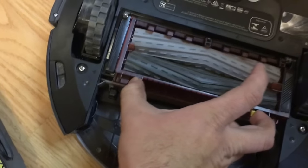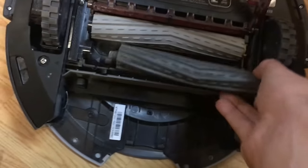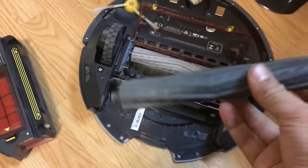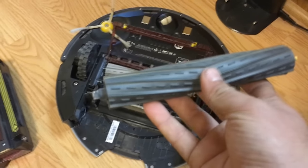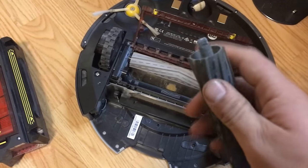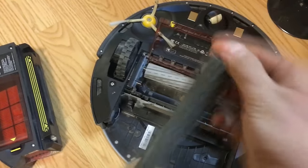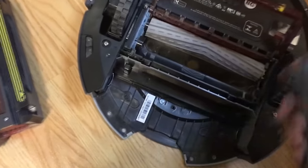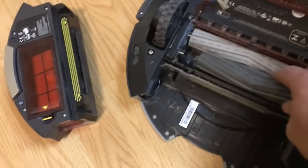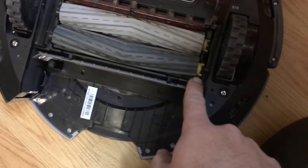All you do is push those two yellow tabs in, and this is all you do to remove them. What's really nice is that, like on a regular vacuum cleaner, you pick up a lot of hair in the brushes and rollers and after a while you have to go in and cut it all out. Well, on these you don't have to do that, because the way it's designed, all the hair gets rolled out to the end and you literally just pull it off. You don't have to cut it. In the event that you need to change your brushes, you just put it back in the hole, line up that end, and there you go.